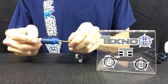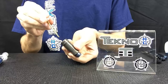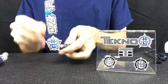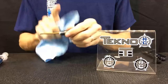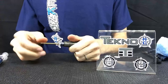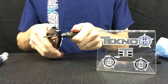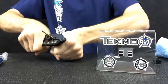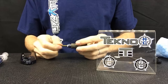Next, I take and put some of that o-ring grease on the threads of the shock shaft because that's what's going to go through the cartridge — I don't want to risk tearing the o-rings at all. That's also why we did not tighten the cartridge yet, so there's no tension on the o-rings. Now that we have the shock shaft through, we can tighten up the cartridge.